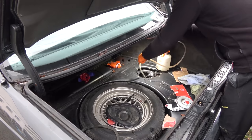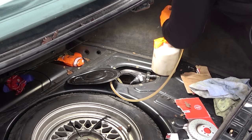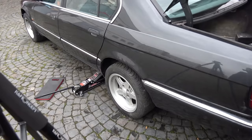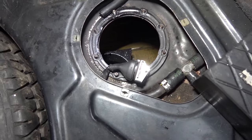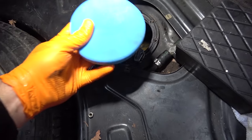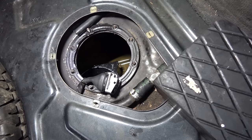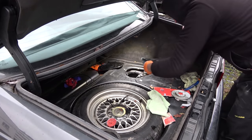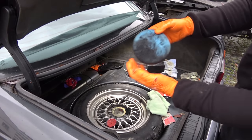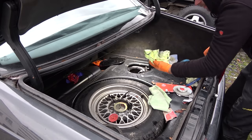Let's go scuba diving. I jacked up the car so that whatever fuel is in the tank is leaning to one side, and I sucked up as much as I could with a little device. I'm going to use a clean sponge to dab and collect whatever is on the very bottom, then a clean microfiber towel to clean everything, add fresh fuel, and repeat until it's really clean. Damn — this is where the fuel pump was sitting. That clean microfiber towel is no longer clean. I'm going to break out the vacuum cleaner.